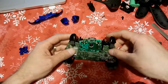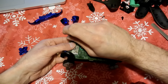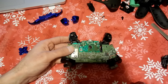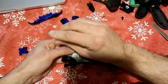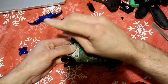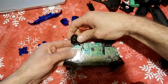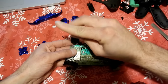There are two T8 screws holding the actual trigger buttons to the back assembly on the controller. Those trigger buttons also have little miniature motors inside of them, so be extra careful. I've actually snapped off the cables and had to re-solder them in this area — they're really easy to break. There are two Torx T8 screws on each trigger. Go ahead and take those two off, and carefully slide the button right out.